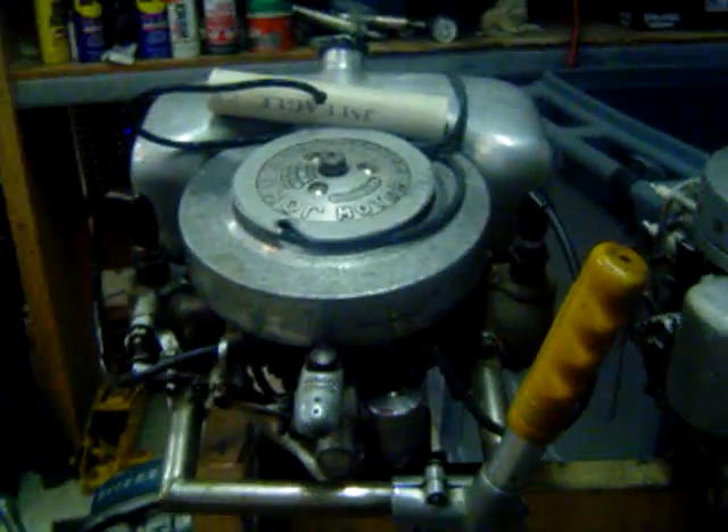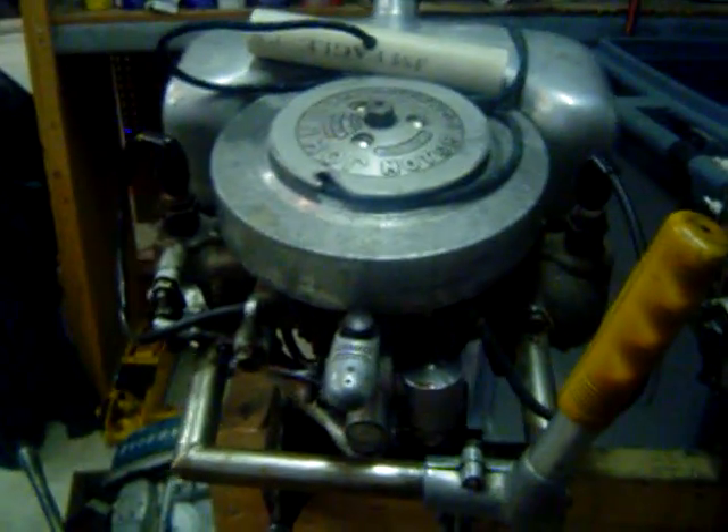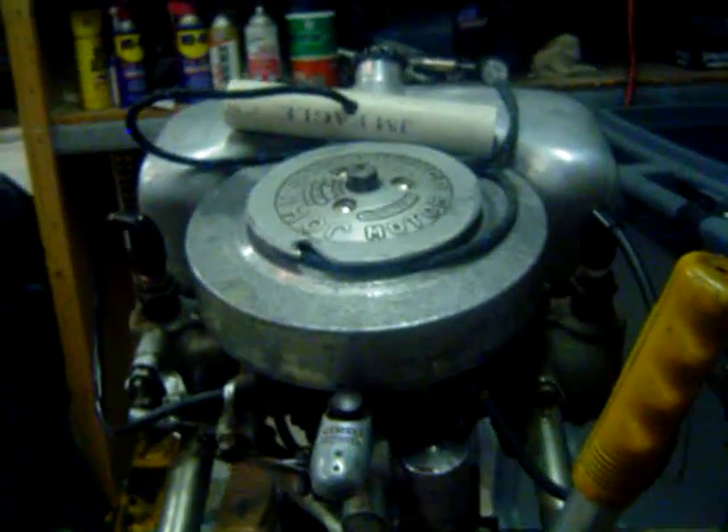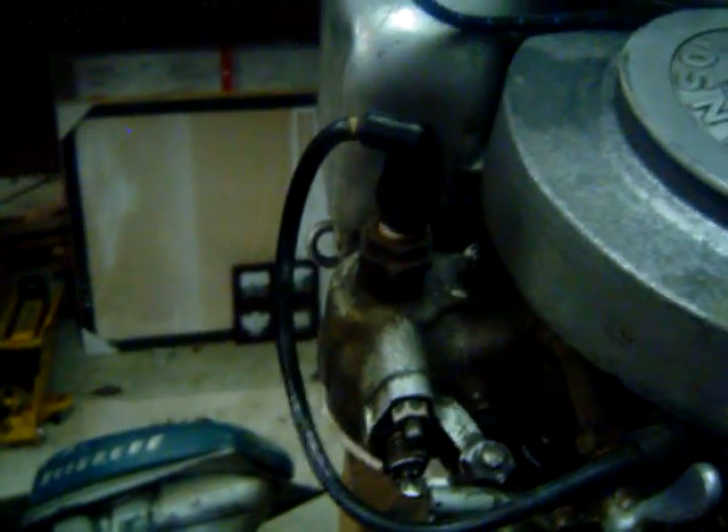Next we have a 1929 Johnson 3 horsepower model A45 — the first 3 horsepower model that Johnson made. This motor runs. It's got two cylinders, no shift, no impeller, but it is water cooled. Nice little motor. It's got this unique knob — you shift it and it shuts off one cylinder, releasing the pressure so it can be a 1.5 horsepower, which is good for fuel economy. It also has a thrust reducer so you can control speed.